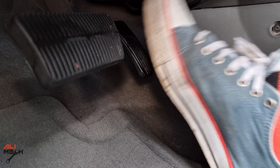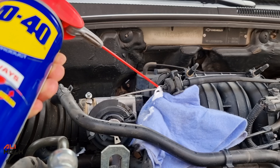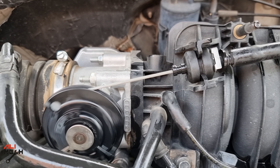If you ever have a heavy or stiff gas pedal, use some WD-40 — it will clean all the dirt and make it soft. But if you put oil on it, it will feel soft at that time, but then it will attract dust and make it even worse.